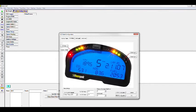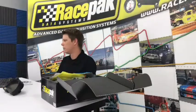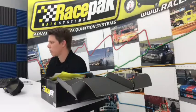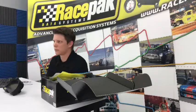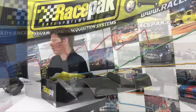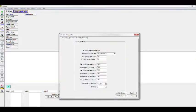Across the top from there, we have kind of the same tab, but it's the shift light tab. This stuff is not really set up per se from us, because that can be so many different configurations when you're talking about different cars. So we have it all kind of at 7,000 RPM to where usually you're not going to hit it. If you want to go through and change all that stuff, you can change the LED intervals, because these are progressive shift lights up here. Or you can also program the RPM drop in the change.